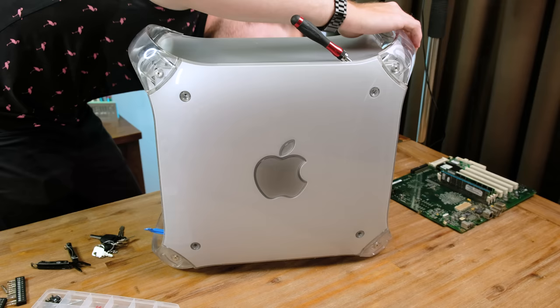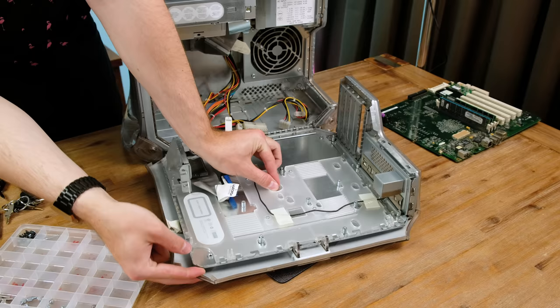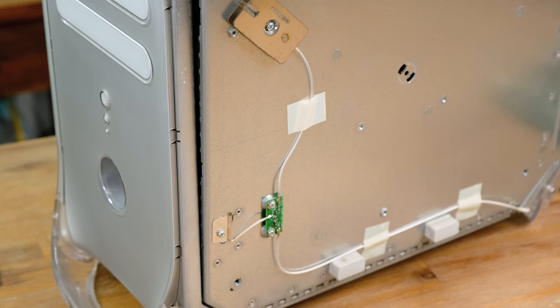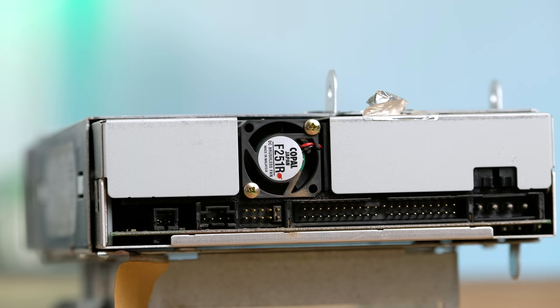It was really hard to unclip the side panel with the power supply and cables still in the way, so I removed the other side panel, which proved to be much easier. The latch that opens the side door also comes off, and with the clip in the center detached, I finally got one of the sides off — which reveals what appear to be Wi-Fi antennas connecting to the optional AirPort wireless card. Next to come out is the optical drive assembly. I was surprised to see that the 2X SuperDrive has a small fan all of its own; I don't think I've ever come across this before.